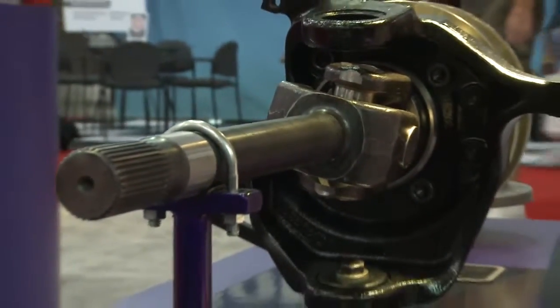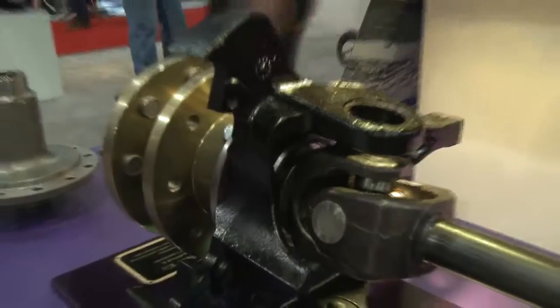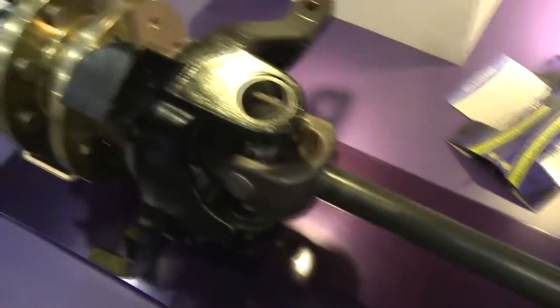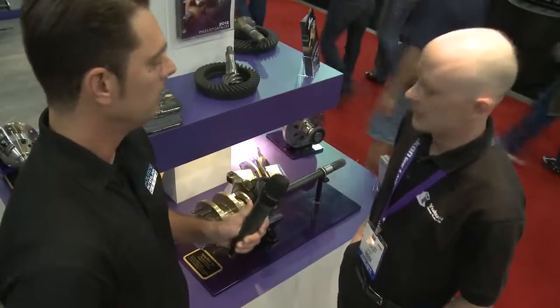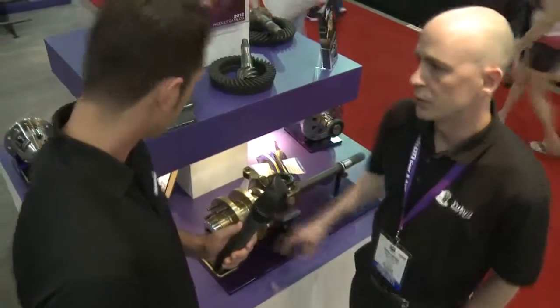And finally, we have the Spin Free Kit. It gets rid of the expensive and vulnerable factory unit bearing. We offer them for the one-ton Dodges from '94 all the way through 2008, and also for a variety of Jeep applications if guys want to run five-on-four-and-a-half or five-on-five-and-a-half. The kit for the one-tons has been the big success for us — we've seen guys in the field getting results of increased miles per gallon by two and a half to three. When this is disengaged, it's not creating wear and tear on the vehicle. That's the other upside to getting rid of the factory unit bearing, and you can also run lockout hubs giving the driver some selectability.